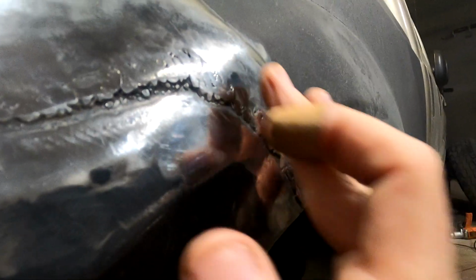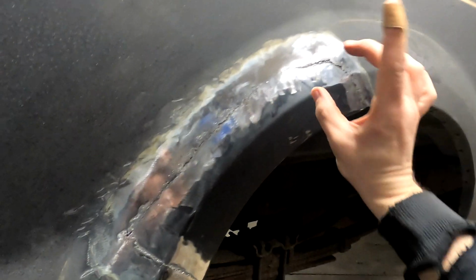But because I'm a knucklehead, you can see right here, there's a ridge, right? And so that would need filler. That won't show up. And I'm not gonna throw on a half inch thick layer like some yahoos you see. They'll just fill a huge dent with filler, and that's not gonna last. It's gonna crack. It's just not gonna work.